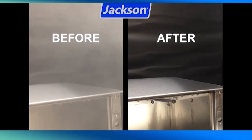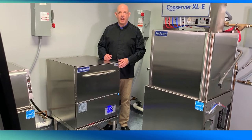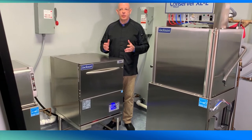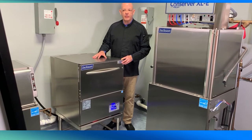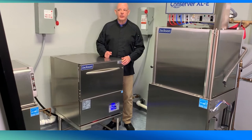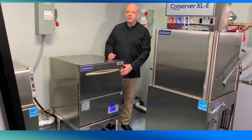The steam elimination and energy recovery system, SEAR, allows for installation at the bar. SEAR collects the hot water vapor generated during the wash and rinse cycles and uses it to preheat the incoming rinse water. This allows the machine to operate from a cold water supply only, saving energy and reducing steam to improve the operator's experience. A door interlock switch comes standard.